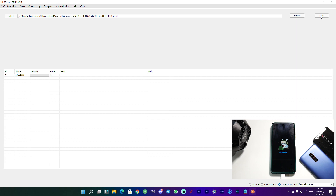Since we're locking the bootloader and flashing an 8 GB ROM, it will take up to 10 minutes or more — be patient. As long as you're not seeing an error or a red line, you're fine. The files listed will keep changing as it flashes. Once complete, the phone will automatically start booting into MIUI, and on the PC you'll see a success message.